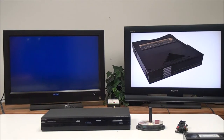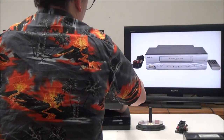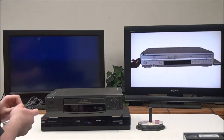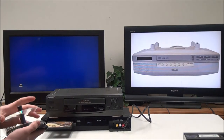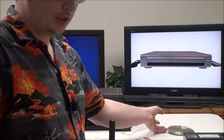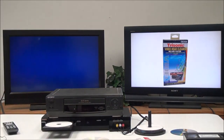We're going to go ahead and record — we'll transfer from a VHS onto a blank disk. We'll hook this VCR up to it using a red, white, and yellow cable, connecting it to the rear of the DVD recorder or the front, and the other end to the output on the VCR. You can use DVD minus or plus R for this, or DVD minus or plus RW. The minus or plus R disks are record-once, or you can use RW which you can record multiple times on — good for if you're planning on deleting what you recorded.